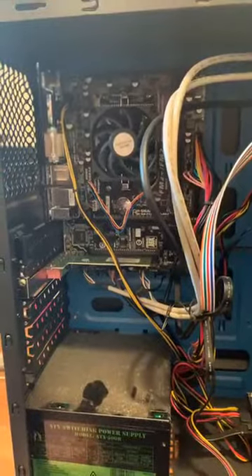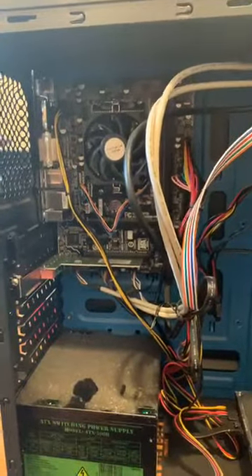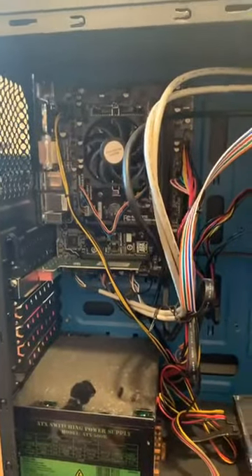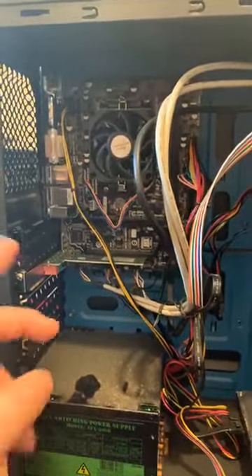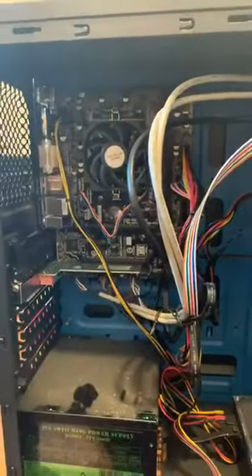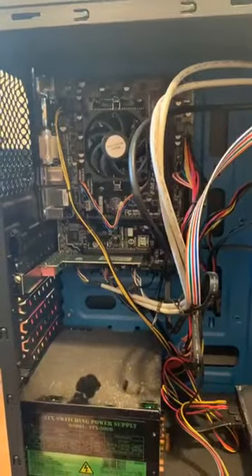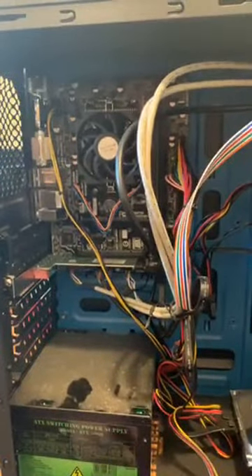Because the radiator's not keeping the processor cool enough, it's a common issue with AMDs. That's why mostly these days I recommend Intel. But if you've got a good cooler on an AMD and you keep them well ventilated and the fans clean, they can go on for years and years. There's also another issue with AMDs: underneath the radiator and fan there's a cooling paste. What happens with AMDs over the years is the cooling paste dries up — and then the radiator gets hot and the board fails.